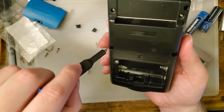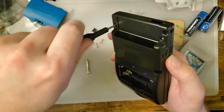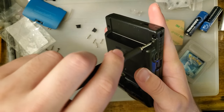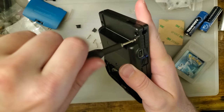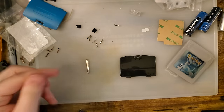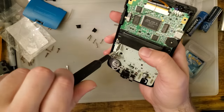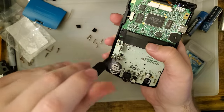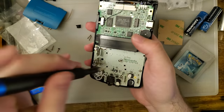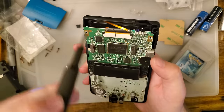So the fix for that, and hopefully this will get fixed with the newer D-pads. I'm assuming those are getting a revision too. Because like the shell, you know, the start and select flashing, that's kind of a bummer. But the fix is to shave down the little nubbin on the D-pad. It's a shame, but it's where we're at. Do take care of your soldered stuff, like that sensor.